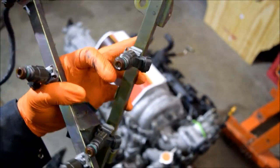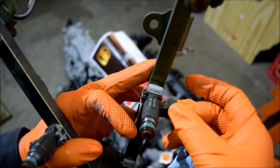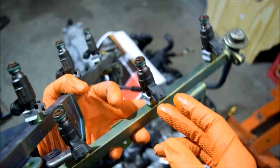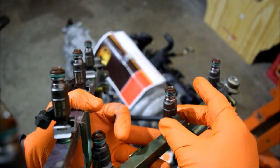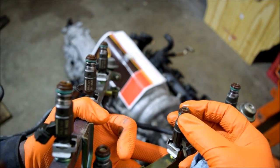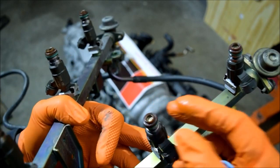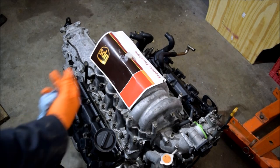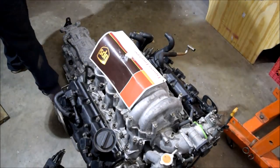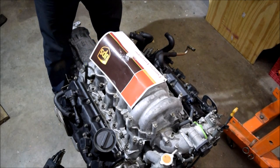This is your injector setup. You actually have an o-ring in there — can't show right now, maybe if I have my older manifold I can show that. Then this is the body of the injector, you have another o-ring over here, and then this horn-colored plastic is the pintle cap. So what I do is just load those up with Vaseline — it's just practice that I was taught: never insert dry.